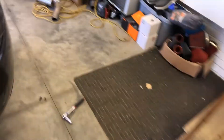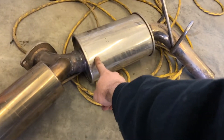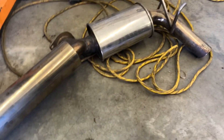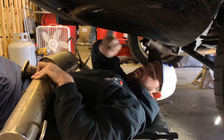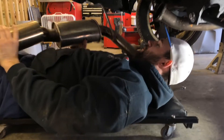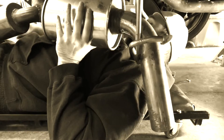In place of the stock muffler we're throwing on a custom muffler Cameron made with 2.5 inch piping. It's got a street muffler and then off the side is a Helmholtz chamber to hopefully help with some of the resonance of the exhaust sound. I'm using saliva to lubricate the three exhaust hangers before putting the muffler in place and bolting it in with the two bolts.